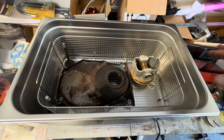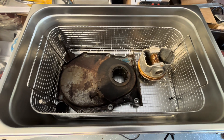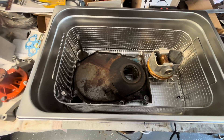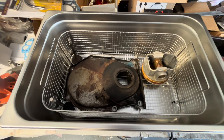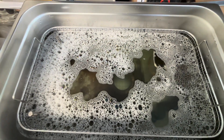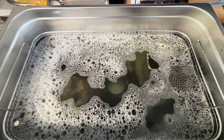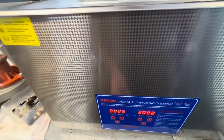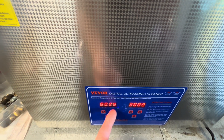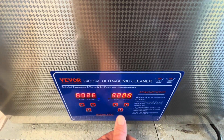I figured I'm going to do probably 50/50 vinegar and water. Everybody on the internet says try different things, but I'll just experiment and see. I'm going to turn the heat on too and put just a big squirt of dish soap in. We are 50/50 with vinegar and water. I had about a cup of Mr. Clean I poured in and then a big squirt of dishwashing soap. The heat is on — I got it set on 80. It's moving up one degree every 30 seconds or so, and I got it set on 30 minutes.